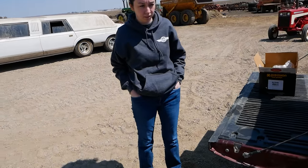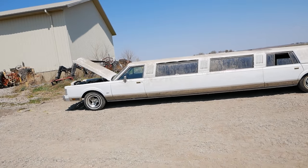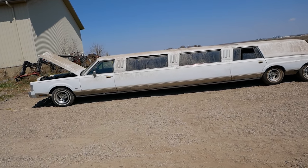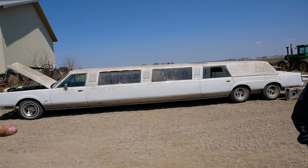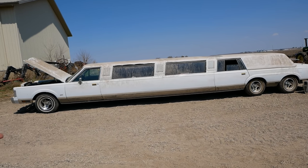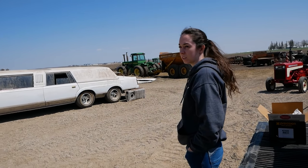Let's get this tank assembled and get that sucker slapped back under the car and then start dealing with everything up front. I thought about it a bit and I think our piston rings are just stuck and we have like no compression, which hopefully after we cranked it to oblivion and back, it sat there with some heat in it and they might have freed up. Otherwise, we are going to be probably pulling the spark plugs and trying to get ATF down the cylinders, which looks to be really difficult because you can barely reach the dang things.